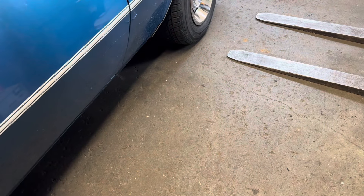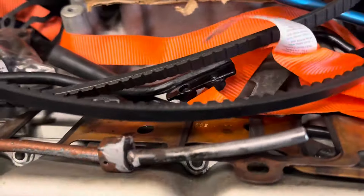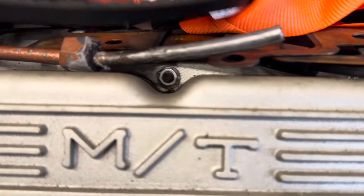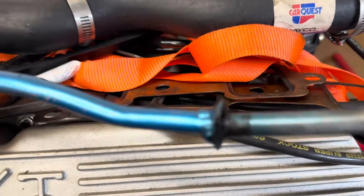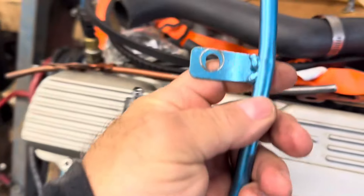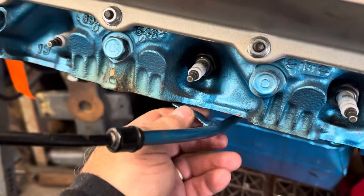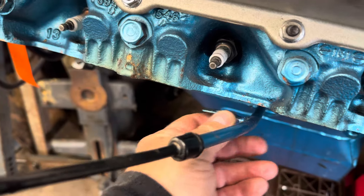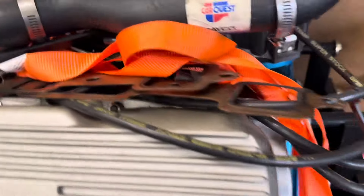So I make my own dipstick tubes with 3/8 steel line. This 455 I used to have had a dipstick tube made from 3/8 steel line. This one is just 3/8 steel line that I bent to fit. I welded a washer on the end, then ground it to clear the block, RTV'd it in, and there's a bolt hole that goes to one of your header bolts. It just slides in here and bolts onto the head right there. My headers went on and it bolted over the header bolt or stud, and that was the story.